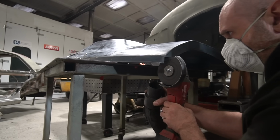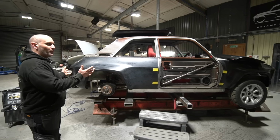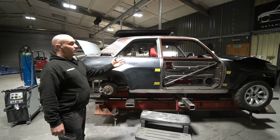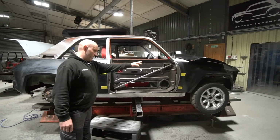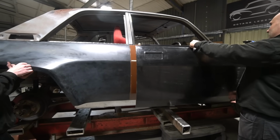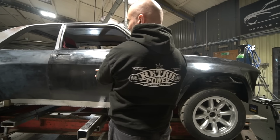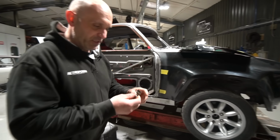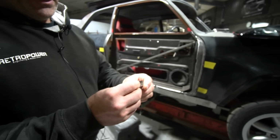And yeah, we just tweak here and there the body shell because we were expecting that we're going to modify the metal to seal the carbon fiber. That was the idea. Yesterday we took off the skin of the door and I made a brace here because as soon as I took off the skin, the door kind of sucked in a little bit, so we lost the initial gaps. So I've done that. I've done also some C-clips. I'll show you on here. That's just a 16 mil square tube. And well, they're not there.